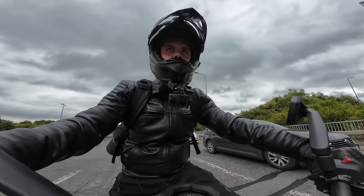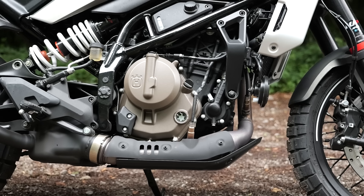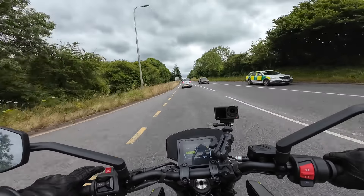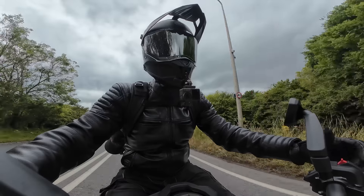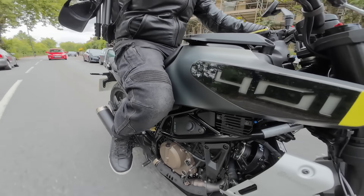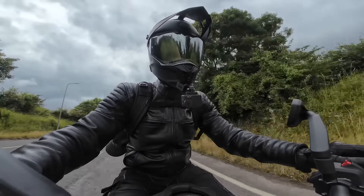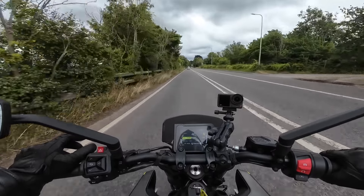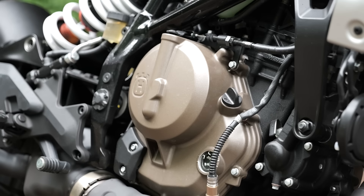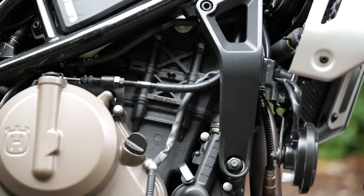It's not exactly a bike that gets you all excited when you get on the gas. Like I say, there is a really nice engine — I like the liveliness at the top, the way it revs up to around eight, nine, ten thousand rpm, and you've got that directness with the throttle that you'd expect from a bike built on a KTM platform. They're always quite eager and this one is very much the same. But the last thing to point out is I'm not sure if that top-end character comes at the sacrifice of a little guts down low, because it does feel weirdly easy to stall right down in the low revs — when you roll up to a junction or traffic light. Even with the clutch pulled in, sometimes it just loses momentum and stops and you have to hit the starter quickly.